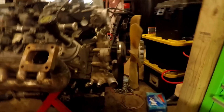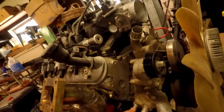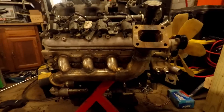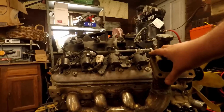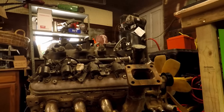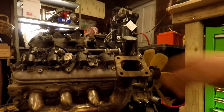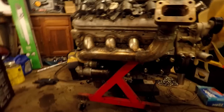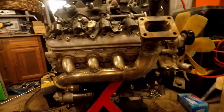The first style is the log manifold. I went ahead and threw the water pump on there so you guys can see what you're going to be up against. The outlets for the heater hose on an LS and the water outlet are right here in front of the manifold. I like the log style because it'll clear the AC compressor and it pretty much clears everything. As long as it doesn't put your turbo out the hood — most shouldn't, because they're going to be lower than the throttle body. This is one I made about two years ago; it's not that great and I'm probably going to remake it, but it did work and you get the idea.